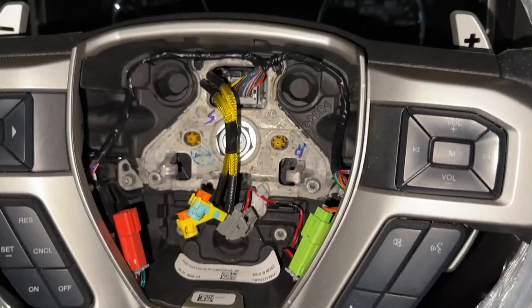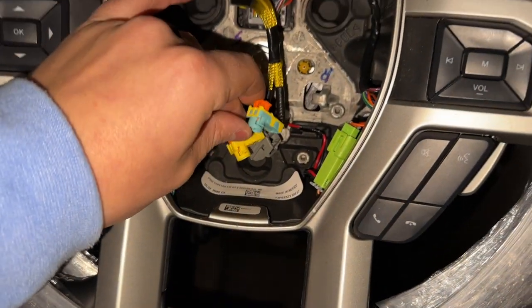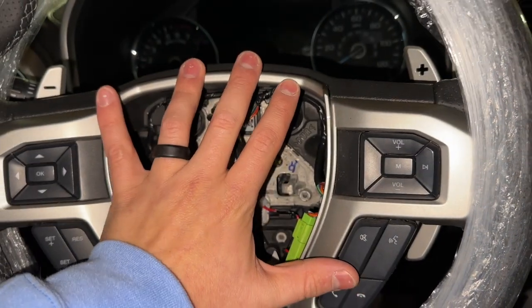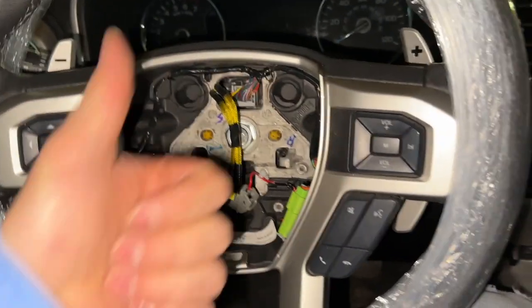Once when it's fairly tight, we're going to torque it down. Now that's tight, I'm going to move it onto my torque wrench and torque it down. Alright guys, now we are torqued down. I'm going to go ahead and install this little red pin here and these two clips as well. The airbag should in theory just push in here and be nice and seated — and that's pretty much it. Connect the battery and hopefully the airbag doesn't go off.